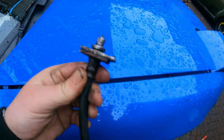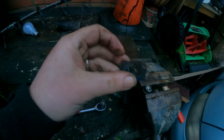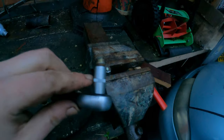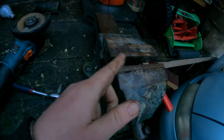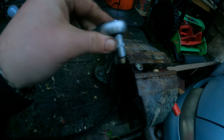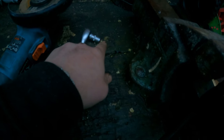It takes like maybe five minutes to weld it back anyway. It is done — look at that! When it was on the car it did not want to get out of the hole at all. What I did was pretty much sacrifice a 10mm socket — I used a grinder to reshape it so the socket could sort of fit on, hammered it on, and then it went. I'd be very lucky to get that 10mm socket back but we don't need that piece back because we've got a spare one.